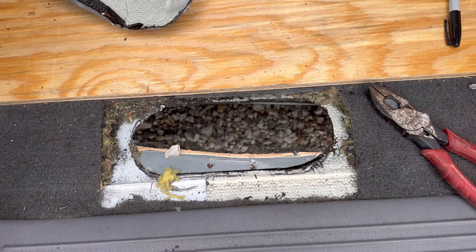As I stated before, I want to make this removable. So what I decided to do is build a little box — this is exactly the same dimensions as the air conditioner. I'm gonna screw this into the existing floor, just shoot a bunch of screws from the backside. I'll put a couple of little eyelets — one inside the box here and one going over there — and it'll hook to this corner right here underneath the AC unit, then go over there, and we'll just be able to cinch it down with a strap. That'll make the AC unit removable.